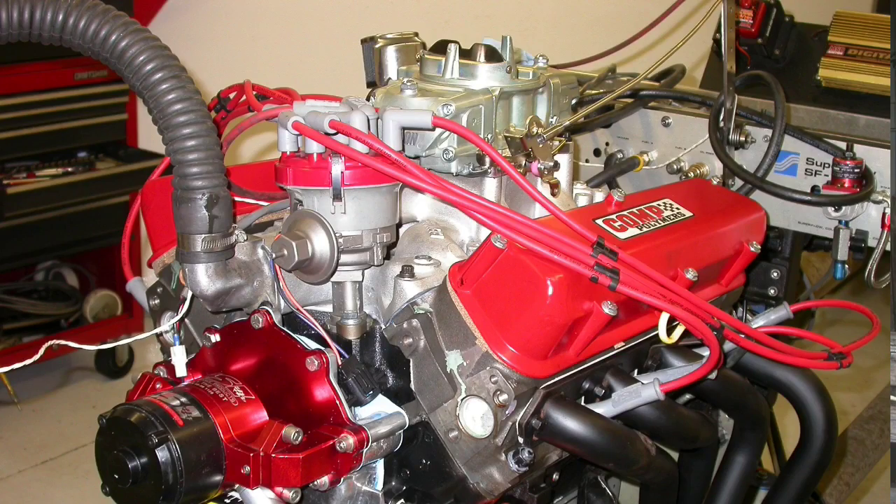What do you think about our 300 horsepower small block Ford combinations? I was very excited about this power level because I had it for so long with my own five-liter Mustang. Back in the day I had a five-liter with Trick Flow heads, a Crane version of the Extreme Energy 274 cam, and a variety of intakes - GT40, Cobra, modified Cobra. That type of combination at that power level is super fun. The only thing more fun than something making 350 horsepower is something making over 400, and after putting a Vortech supercharger on my combination it made a lot more power and was a lot more fun to drive. Keep watching - 400 horsepower combination videos are coming up next.